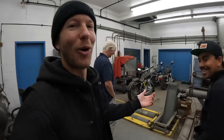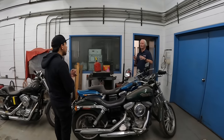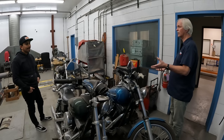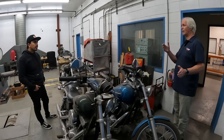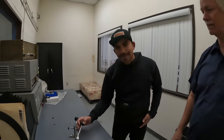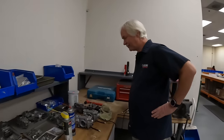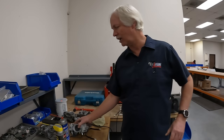He can put all this stuff to good use. We're doing kit development — all rebuilt kits mostly for all the different carbs that are out there. Harley's one of our biggest markets. I think they ran a carburetor up to like 2005 or 2006. They ran them so long that guys who have bikes with carburetors, even if they bought a 42, are now replacing it again with a new 42. Can you imagine being on the R&D team here in the 80s with a race motor connected to the scale thing? When they would put the motor in there, you'd stay outside, then throttle up — the building was shaking. Freaking rad. Now we're dealing with counterfeit carbs — they're quite a bit different: steel pistons in them, jets are wrong, top covers have big gaps.